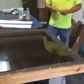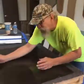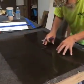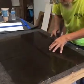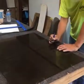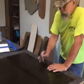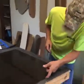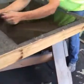Hopefully we don't see any blood here today, but it does have that potential. It's glass. I've got the one side scored already. I've got my mark here, and I can actually see the score through it as well as the mark that I've made. So I want to be as close on top of that other line as I can. That way when the glass breaks, it's going to be even on both sides. I cut this earlier. You can kind of see it's even on both sides.